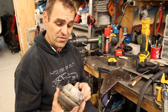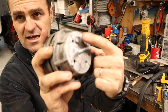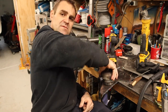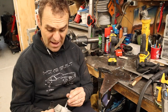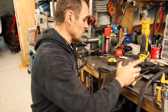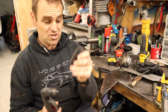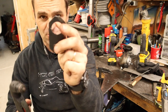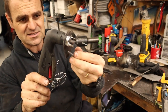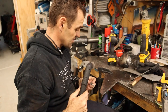I spent a bit of time drilling holes to make my base plates. The base plate has a locating lug as well as a locating nub, so I've drilled them so it fits in nice and solid. Now I want to cut out a couple of circles from the 6mm plate — I'm going to use the plasma cutter. A tip I got from Urchfab: I've made a little attachment that sits onto my plasma cutter so I can stick a bolt through the piece I want to cut, swing it around, and cut a nice even hole out of the plate.